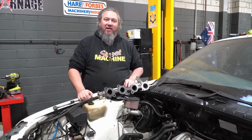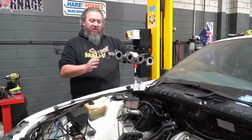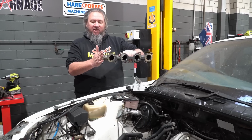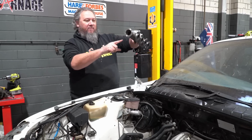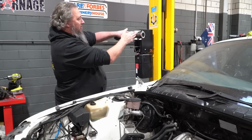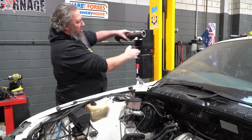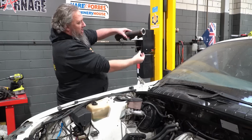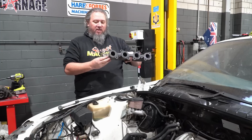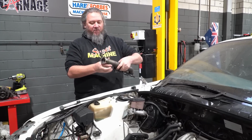Now that we've got the engine out, a couple of things have to happen. We have to modify our exhaust manifold. Now we know that is as far forward as we can come. So we're gonna have to come out of our manifold and sort of cut that off, maybe even cut it off really short, and either come like hard 90 there or even come out the bottom here and seal off the front. That's gonna take some thought. I'll talk to some people about that.